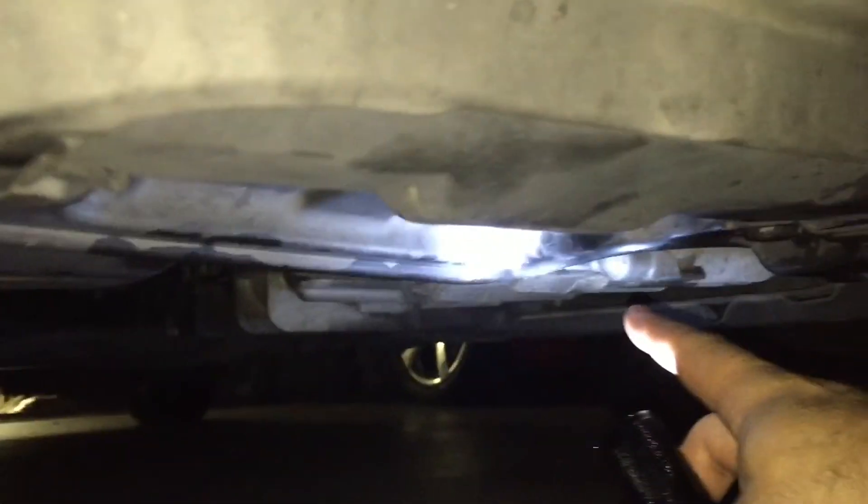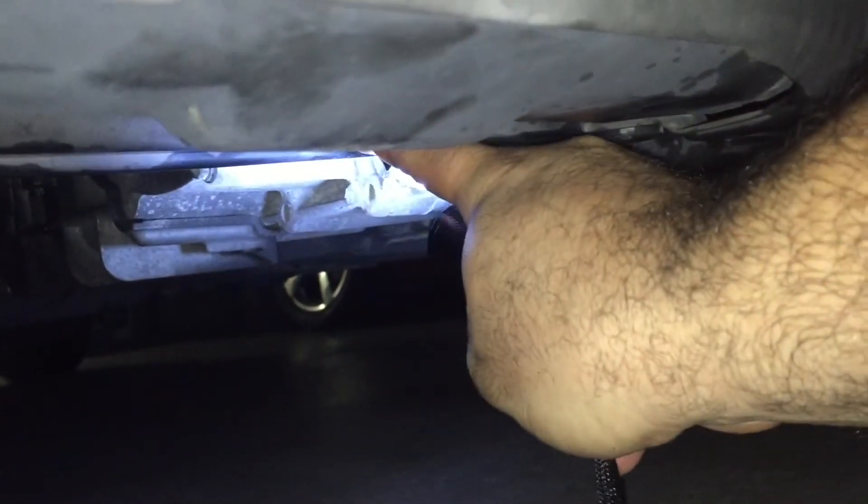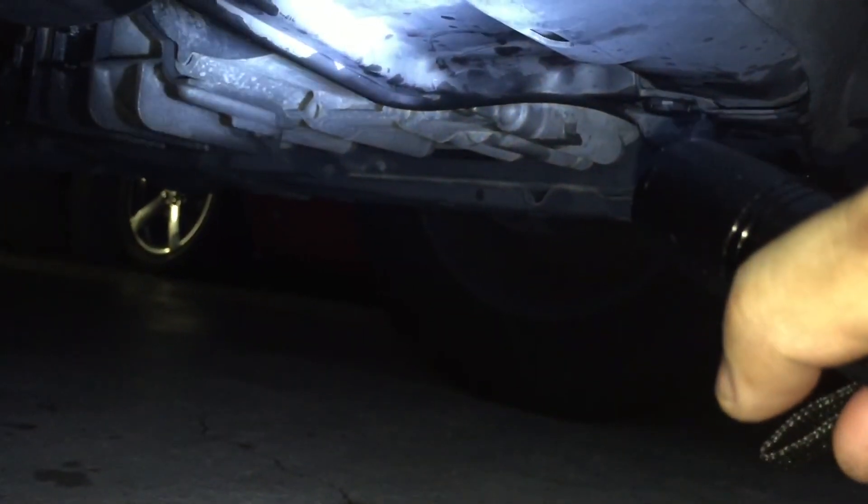I hope this helps. This was a very quick video because there was no such thing on YouTube for a 2007 Honda Element showing how to change the transmission fluid. Just as a recap: that's the front of the car. If you go underneath the car, directly underneath, that's where your transmission plug is — sometimes it's indicated by a little blue thing. A regular standard ratchet fits right there — nothing else needed. Four quarts and you're good to go. This whole thing took maybe 15 minutes from start to finish. Hope this helps, good night.